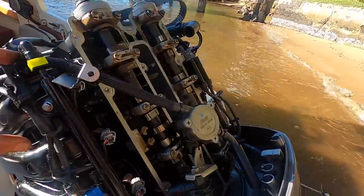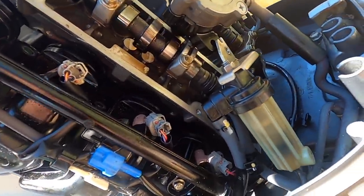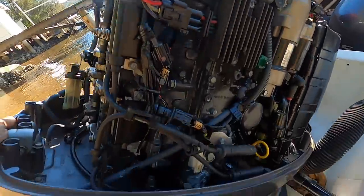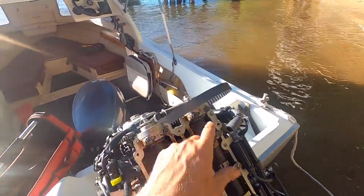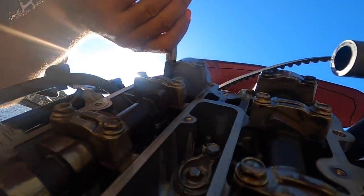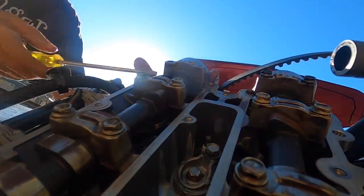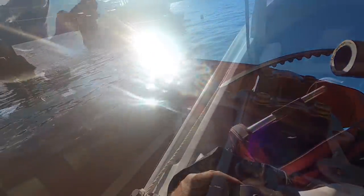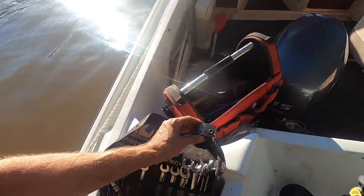I've backed them all off here, so you can see it comes away enough to get the head off, no dramas. Looks like maybe O-rings — yeah, it looks like O-rings inside the plastic inlet manifold. So bolts on the exhaust side are straightforward enough. I'm going to put the cams into a clean rag each, but I'm going to put all these bearing caps back on exactly as they came off. Just going to lay them out, same order, same orientation, then we'll put them back.